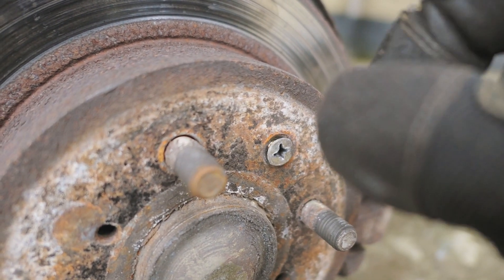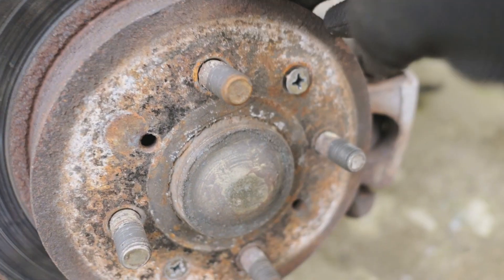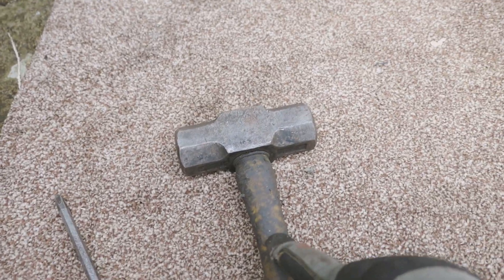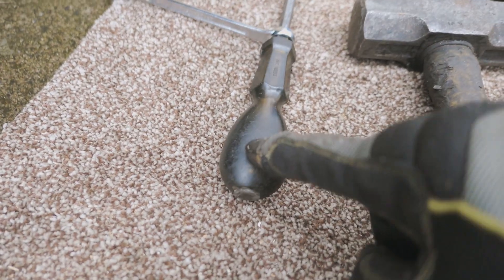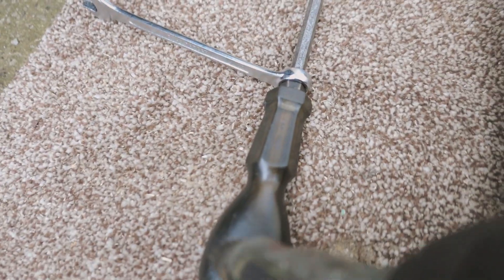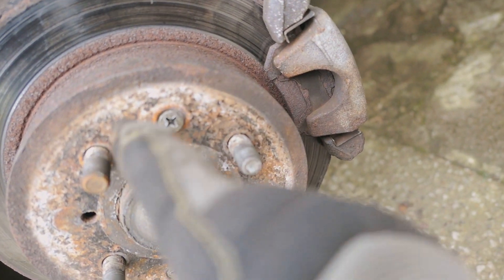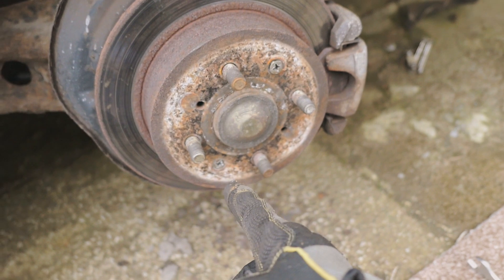This hopefully won't happen to you, but unfortunately in removing the discs, the locating screws for the disc became seized. These screws are chamfered so they align the disc perfectly centrally to the hub. I've been hammering the crap out of them, even swapped to a much larger hammer. I've been using a specifically made Phillips 3 screwdriver that's steel all the way through - made to hammer and shock out screws like this - very useful in situations like this. But it didn't work, so I ended up putting a lot of pressure on it to avoid stripping the head, and used a spanner to get more leverage on turning the screw out. It worked.